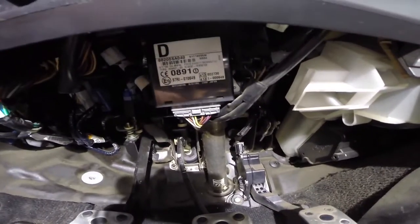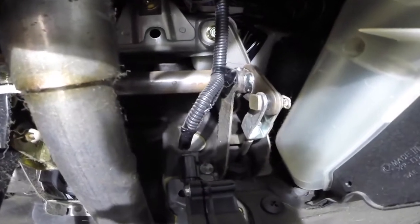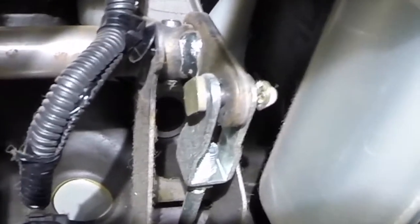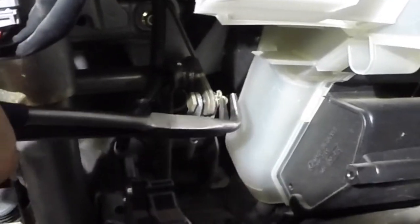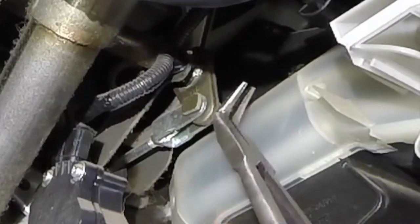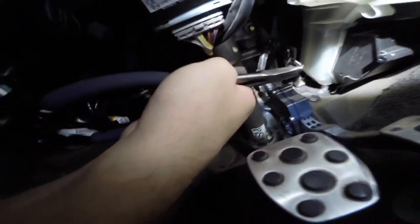We're going into the car under where the pedals are and we're gonna pull the pin that's holding the linkage to the master cylinder. Here's your clutch — you can see it links all the way over, you can see it right there. So hopefully I'm just going to pull that pin out and that'll release it from the master cylinder. I'm using my offset pliers here — can't get a good angle on it. There was a little plastic piece on the very edge of the pin; I just pulled that right off with some pliers. There we go — there's the pin. Now our master cylinder is free and ready to go.